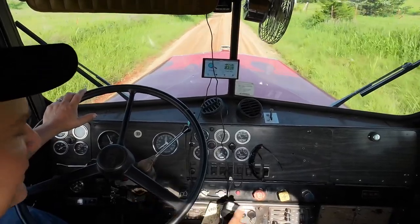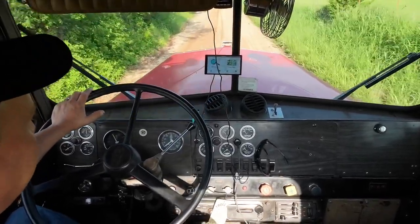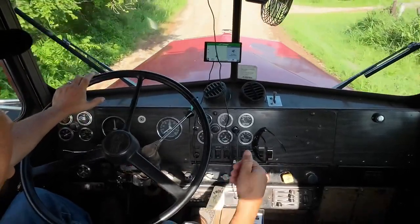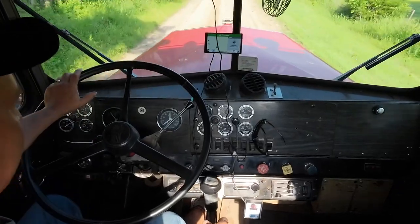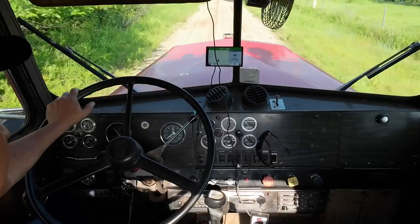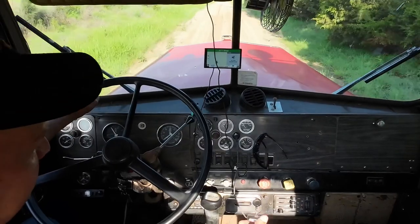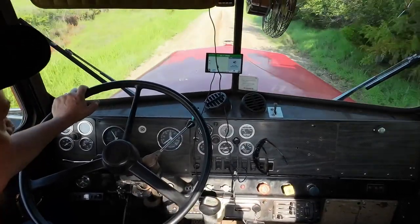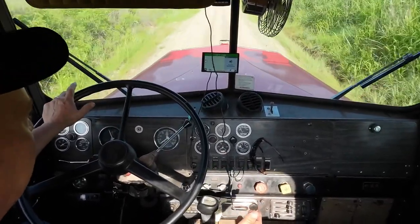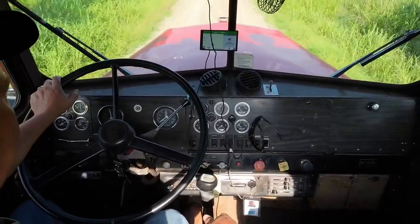The next shift will actually be up to high range. We went through low gear into 5th, then from deep reduction 5th gear into low gear 5th gear — it's about the same difference. The book says you're actually supposed to downshift a gear, but I find it easier to just pull it out and right back into the same gear. It works pretty well that way, whether it's overdrive or non-overdrive.